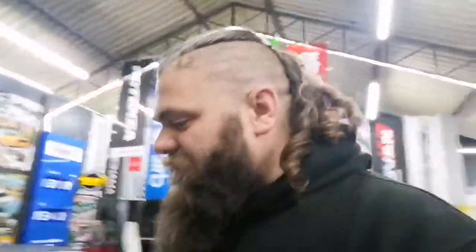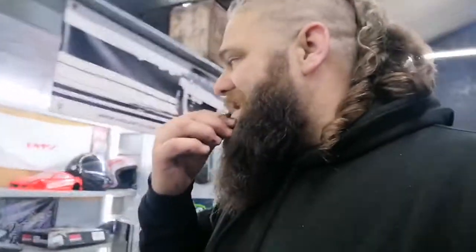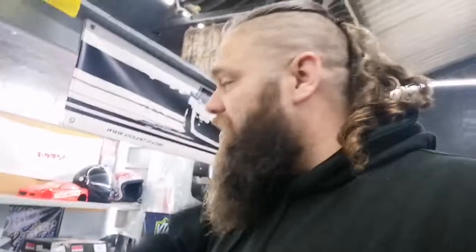I've left them in here overnight because I thought it gets colder in here overnight - it's just an old barn effectively so it gets like minus three in here. If it's going to crack it's going to crack tonight, so I'd rather it do it now. If it does crack I'll probably have to change it up and maybe do some plexiglass. It needs to be like two or three mil stuff to get around that curve. This is a lighting diffuser panel - I wanted the diffuser panel because it's got that texture in it so it muffles all of that chrome behind. But if not, I'll probably have to get plexiglass tinted from behind - maybe do a frosted tint or a coloured tint.